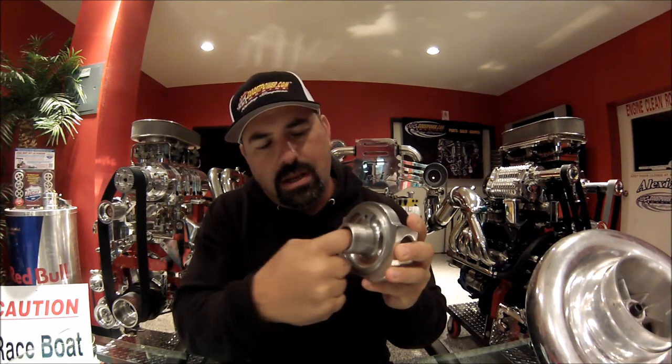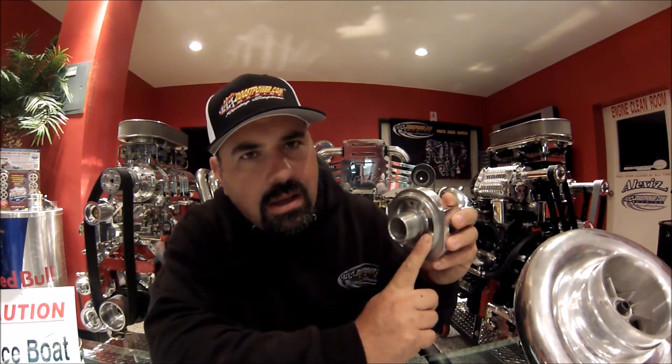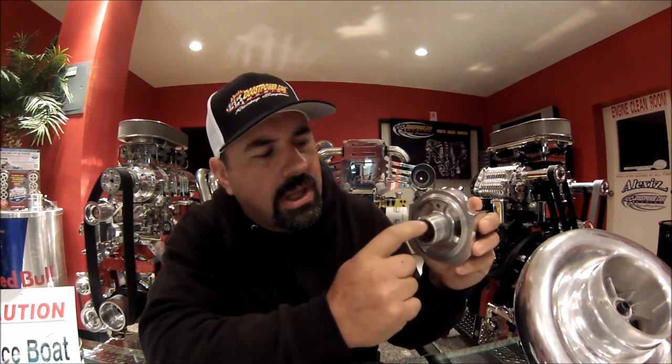Here's the filter head. This is the inlet to the engine. On your engine you'll have an oil filter that screws onto the block — oil comes in to the outside of the filter and exits through the middle, clean, into the engine. When it's remote-located, you want to make sure the oil is exiting the engine on the outside of the filter and entering the engine through the middle.